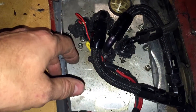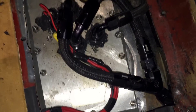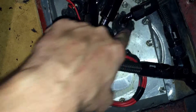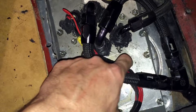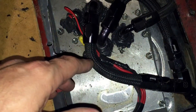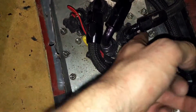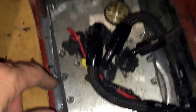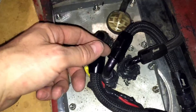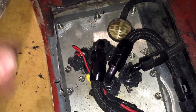Right now my tank is full of fuel and I really don't want to pull this out because I'm in my garage and it's going to reek. At any rate, that is my fuel hat. It took quite a long time. The fuel tank — you can see that circle is the outline of where the original pump sat, which was just right here. All I did was take some tin snips. I didn't want to cut on the tank with a power tool because I didn't want to create heat or cause a fire. So I took tin snips and just started where the hole was and cut a square straight up, over, and around. Pretty easy deal. With the rest of the holes, I used a lot of oil and a drill bit and a magnet. I had magnets all over the inside and a drill bit with a bunch of oil on it, and I just drilled, took my time. It probably took me three hours to drill all 12 of those holes.